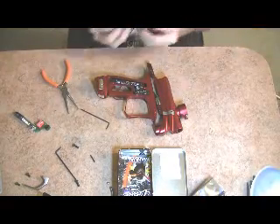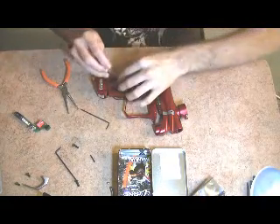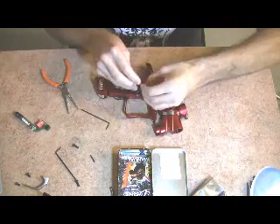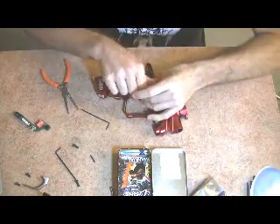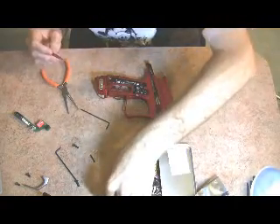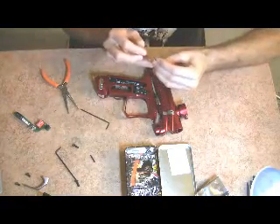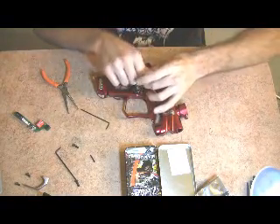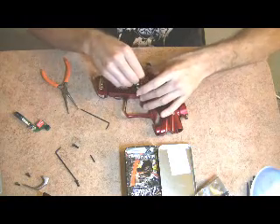The board is in there now. Let's take the three board screws. I always recommend getting all board screws in place first and then tightening them second — sometimes if you tighten down that first screw, the other two may not line up properly. So put them in loose first, and once all the board screws are in and everything's lined up perfectly, then go ahead and snug them down.